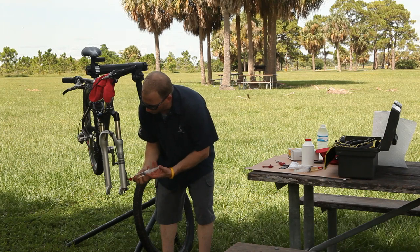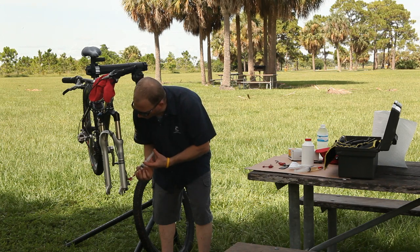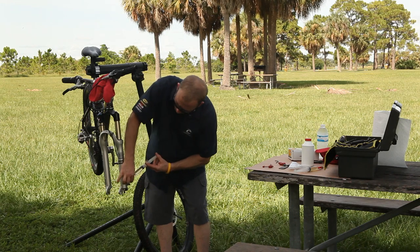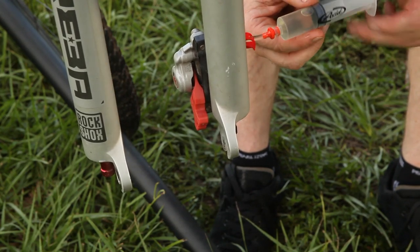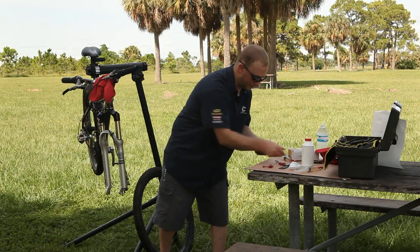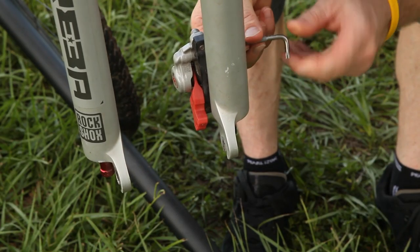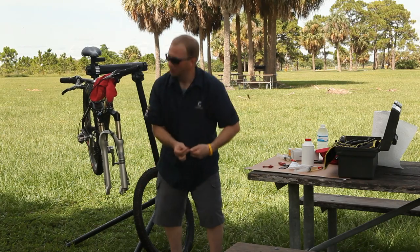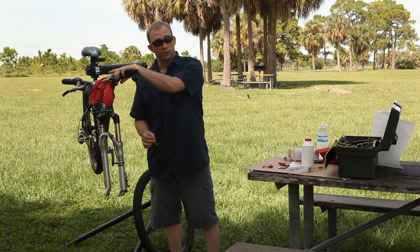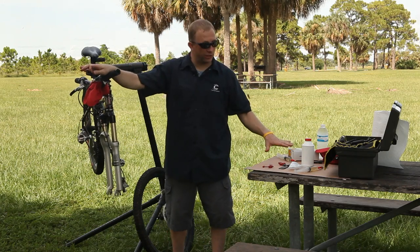Now we can do the lower part. The first thing I'm going to do is just top it off — make sure there's no air in there. Just top off the fluid and make sure that it feels good. Lock that up and remove the lower syringe. Put on the lower plug. Then make sure that your lever feels good and you get some good lever feel out of that brake. That's how we bleed a disc brake using the Avid system on a mountain bike.